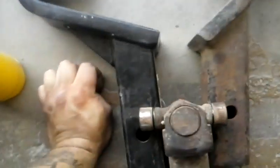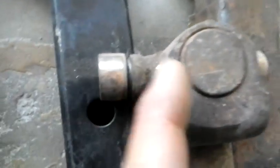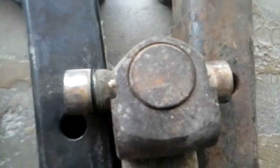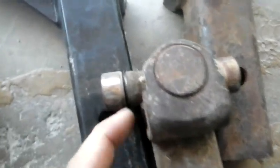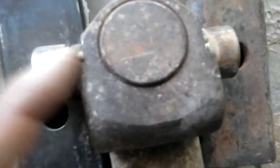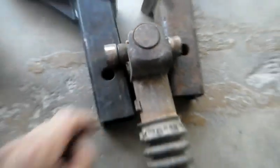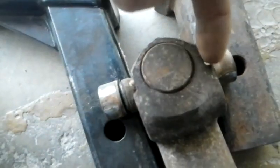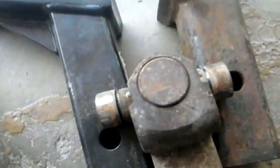This is a drive shaft out of the Jeep that I'm replacing the transmission on. These U-joints have a plastic pin inside of them. Unless you get that plastic pin out, you'll never get this U-joint out. So whenever you see this plastic piece right here, know that you're going to have to use heat to get this U-joint out. But even if you don't have this plastic pin, you can still use heat and heat it up all around the crown here to get this U-joint out.